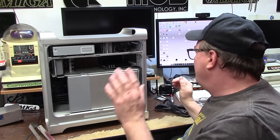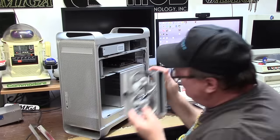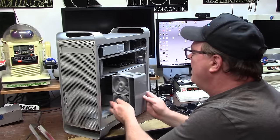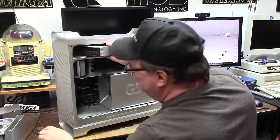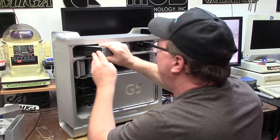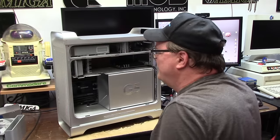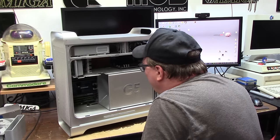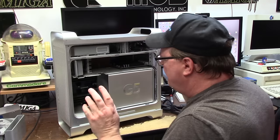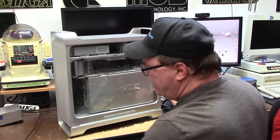We're going to remove this and look at the processor module — G5 single processor, one processor, and it is a monster. Same plastic layout here. The SuperDrive has been smashed out; it doesn't look connected. It has a hard drive of unknown brand, a graphics card of unknown, and a big heat sink. She is PCI Express — mine was PCI Extended. Two fans in the back, two triple blades in the front, a massive heat sink with a big vent, eight sticks of RAM of unknown, a little dusty. The drive took a hit in shipping — it broke the bracket.